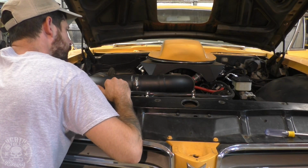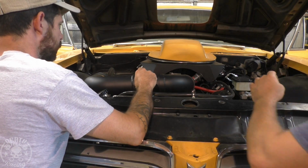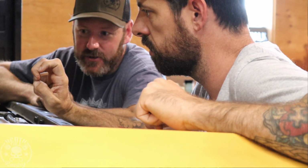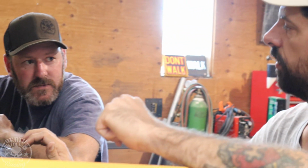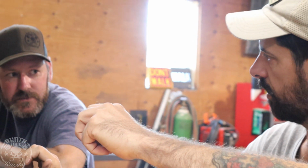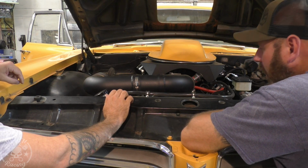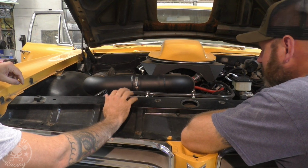Do you have the intake tube for this engine? No, it was in a wreck. It was destroyed. So we can Google that, or we can go to Spalding's and see if they have one. Yeah, that's what I'd be curious about. I'm really confused as to why the voltage was going so high up and down, but it did that after we removed the filter. On the oxygen sensor? On the mass airflow sensor. Oh yeah, like it's getting cavitation or something? Yeah.